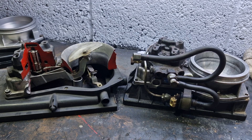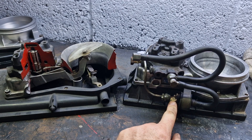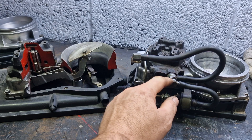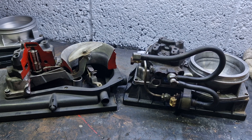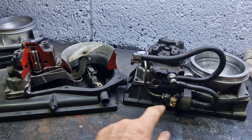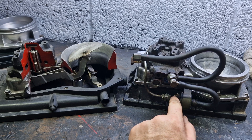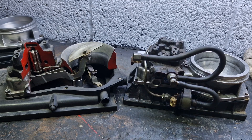If you're not building system pressure, this valve could be stuck open. To test it: take this banjo off, take this pipe off, put the valve in a bottle, and put a solid threaded bolt — not a banjo, a bolt — in the port to seal it closed. Turn the ignition on to run the primary fuel pump. If you get any fuel out of the valve, it's not working — it's meant to be closed. If nothing comes out when it's unplugged with no power, statically that's fine.